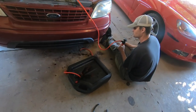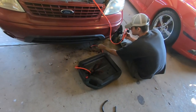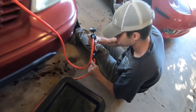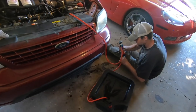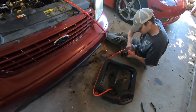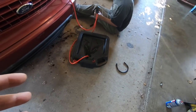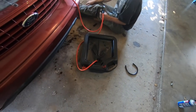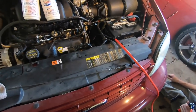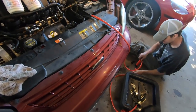The hose just blew off and my brother's got transmission fluid pouring all over his leg. Typically this is not a messy job - you just pump it out into your drain pan. It's a completely mess-less job normally, easy way to get the old fluid out and put the new in. But if you go and flush out all that friction material and put fresh fluid in, you no longer have the abrasiveness of the dirty fluid to keep the clutches working. There are times when the fluid is really neglected that you do not want to change much of it.